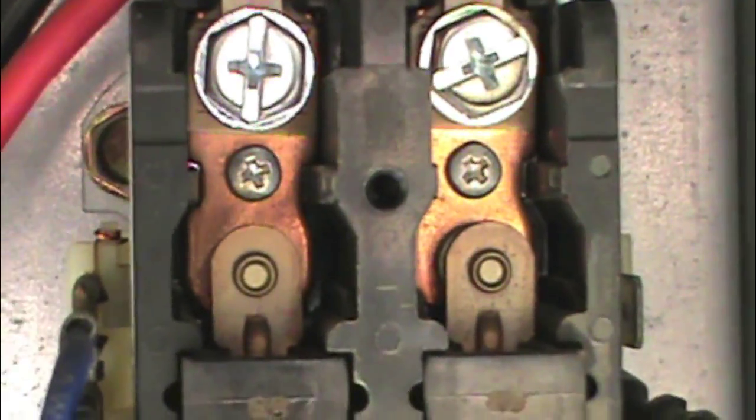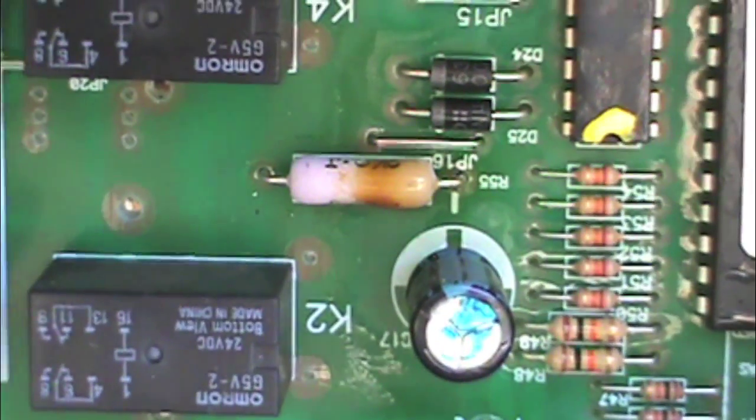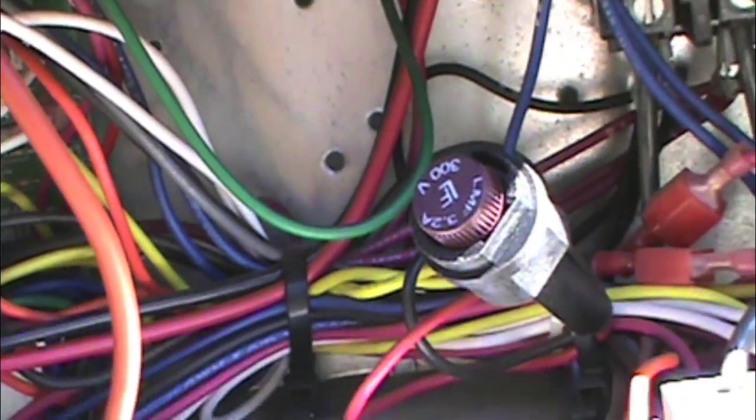Just generally looking around — I like to observe everything and make sure we don't have any burns, we don't have any melted insulation, we don't have any problems. The only thing I'm looking at is some discoloration on our resistor — this is pretty typical of when you see the high-voltage igniters. Parts of the board tend to heat up, certain components heat up, and you get situations like this. Eventually this will fail, but it's probably going to be years and years down the line. That is a telltale sign there, but all the wiring looks good, everything looks good. Let's fire back up and see what she does.